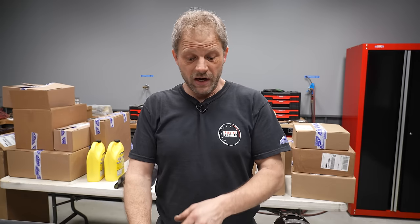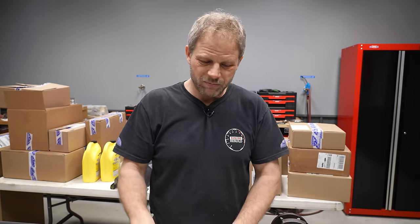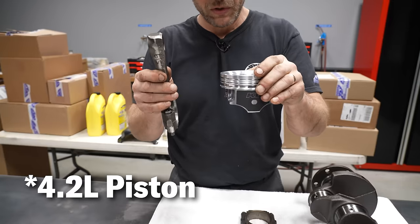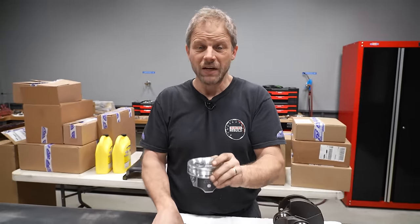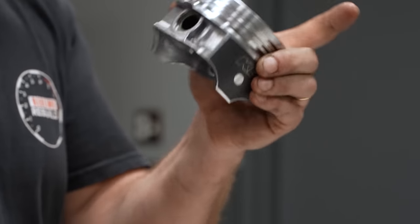Now when I was going through all this, I ordered a set of fresh reconditioned 4.2 liter rods, and with that I also got a brand new set of pistons. Everything's working out great — until I did the math and said, hold the phone, got a problem. If I take this four liter piston and this 4.2 liter rod, it's shorter, and this bad boy is going to be a quarter inch hanging down in the hole. Not so good for compression — it'd be closer to a Model A at about six and a half. So, small mistake. Here's my RockAuto.com tip of the day: do your research, then do the math to make sure your research makes sense.